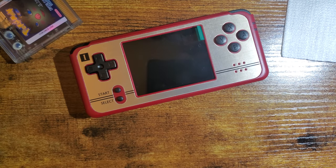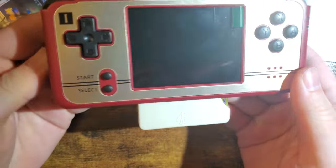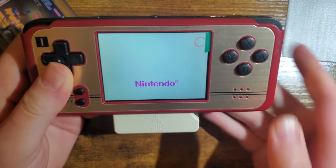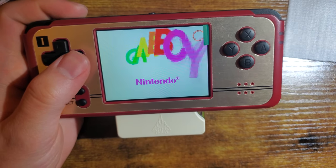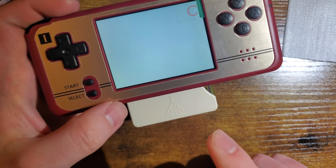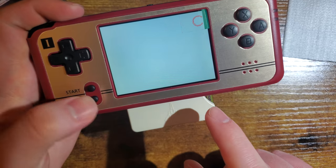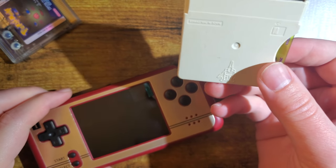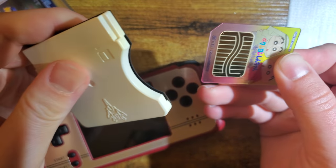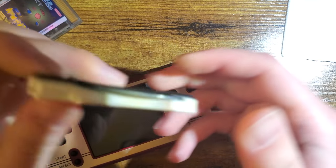Alright, so of course the first game I pick up has some weird quirks. Let's try more weird games, huh? Yeah, that's what I thought. This thing doesn't seem to work on anything except basically unmodified Game Boys. It'll work on a modified Game Boy. I just mean that if there's anything that messes with the clock signal on the Game Boy, it'll fail to read the card. I don't know what it is specifically.